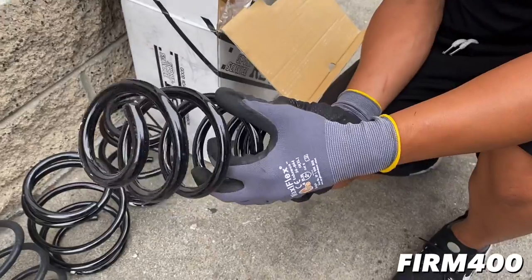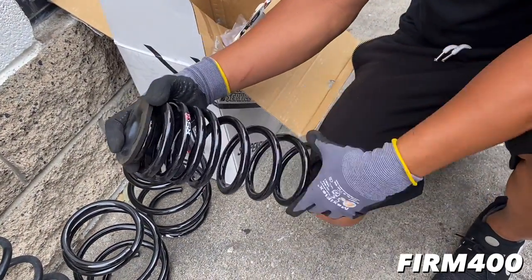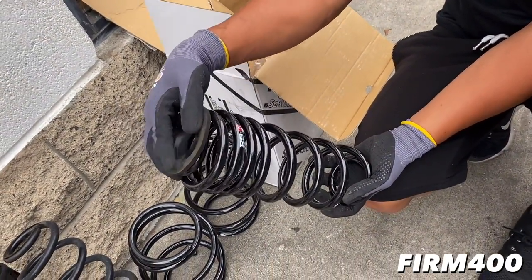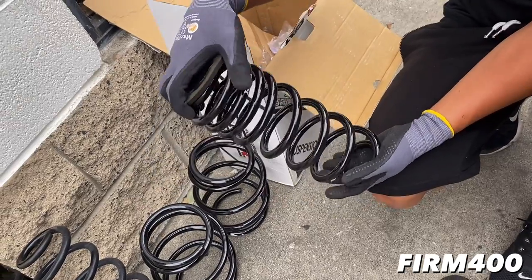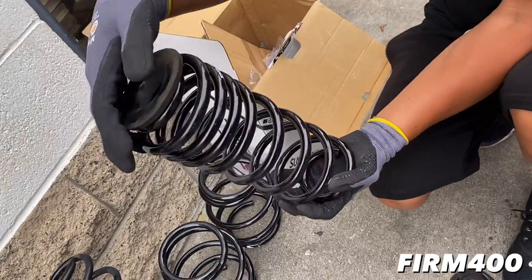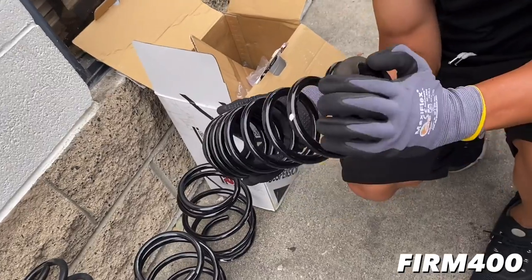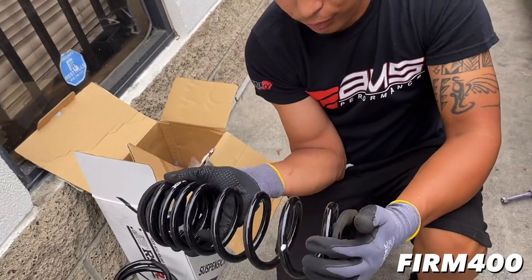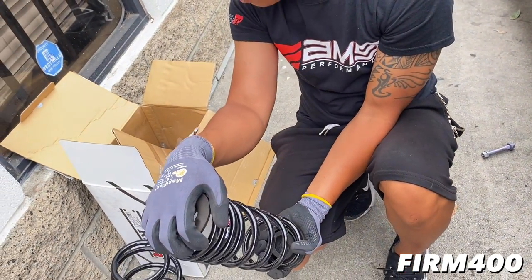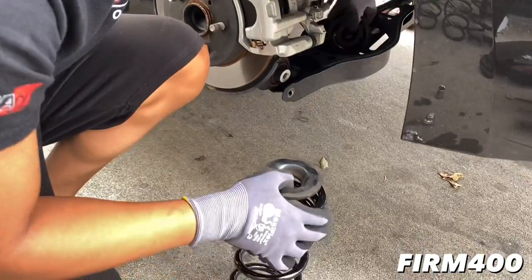With these, a lot of people get the orientation mixed up because the top and bottom mount is all the same. I just like putting the logo facing up so you can read it correctly. Have you installed any of these in the past? Yes, they're pretty good - they're pretty stiff for springs. It gives about a 1.5 inch drop. Nice. Installation is pretty straightforward.